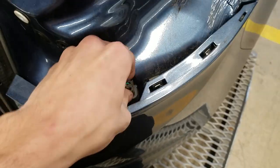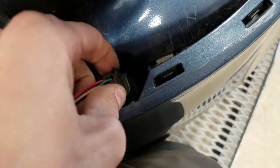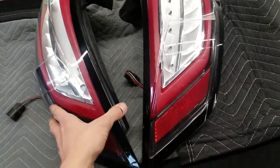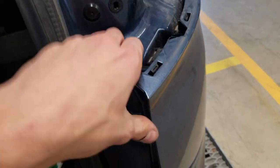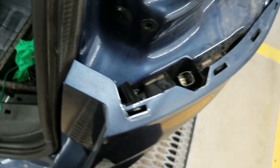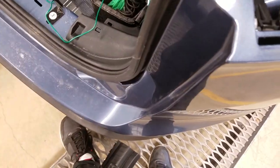For the right tail light side, it's kind of a hard job to do with one hand. You're going to unplug that and set the tail light aside. Then pull back on the trim panel — there's a clip that has to pop out, so pull backwards right there. You might feel like you're going to break it but you're not; they're just clips, though be careful as some clips could break.